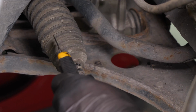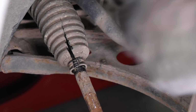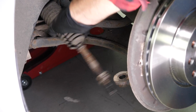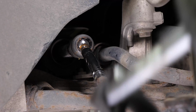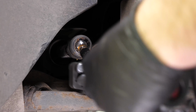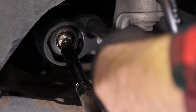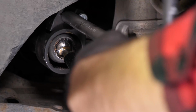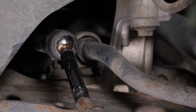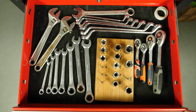With a cutter, cut the external part of the sleeve so that you can remove it. Using a tie rod iron or extractor, a specific tool for carrying out this job, you can now loosen everything without difficulty. To do this, insert the tool up to the fixed part of the tie rod, then, with a socket wrench and a long extender, force it in an anti-clockwise direction. If the tie rod axle joint is equipped with marks, release them using adjustable spanners.